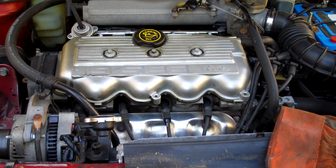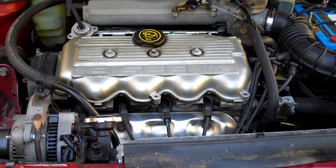What I want to do is see if I can determine what cylinder might be the problem. I'm going to take spark plug wires off this thing one at a time and see if any of that makes the noise settle down.